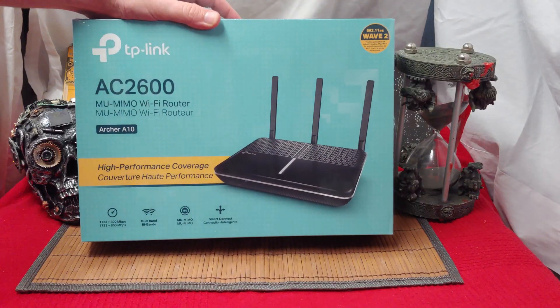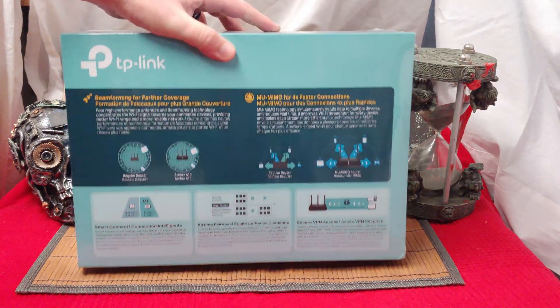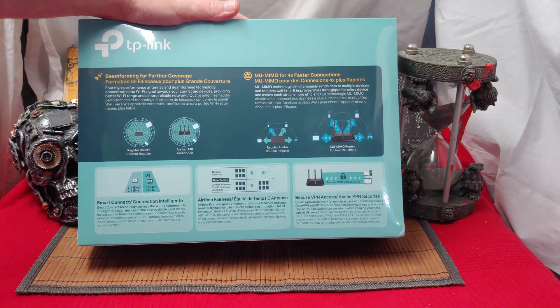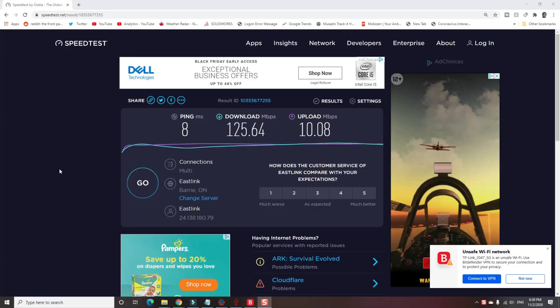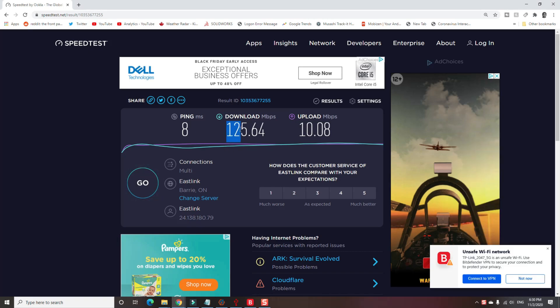You'll see soon the difference between Wi-Fi N 4 and Wi-Fi AC 5 download speeds. Next up, let's look at the AC units — Wi-Fi 5. I have a TP-Link and an ASUS to test. This is what I'm talking about when I say you should get an AC or Wi-Fi 5 unit. Look at the difference: on the N I got 10 megabits, and on this I get 125 megabits — that's as high as my provider will give me. I definitely recommend spending about $80 to get an AC Wi-Fi 5 unit.